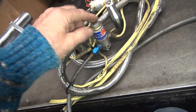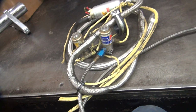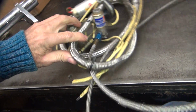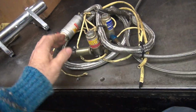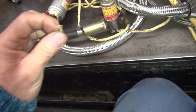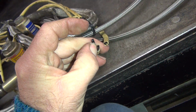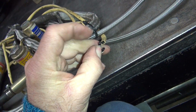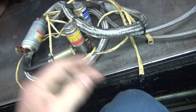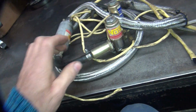Over here, this is your gas solenoid, so gas is going to be the good stuff. That'd be called the stuff that's in that bottle right there. That's the nitrous. So that's what these are for. So that's how they're supposed to work. So this one here has the little plastic hoses on it for feeding. There's the hose. So these go to little fogger nozzles. They're funnel shaped, usually jet styles. These little plastic things, these little thin tubes are easy to hide. These little small nitrous solenoids are really easy to hide. And fuel pumps are easy to hide. So all this stuff's pretty easy to hide.